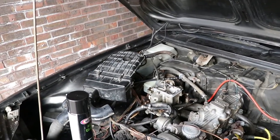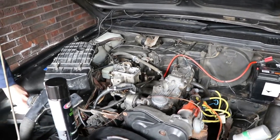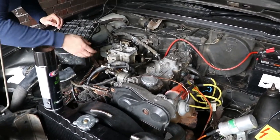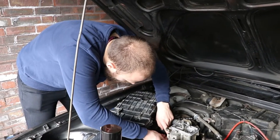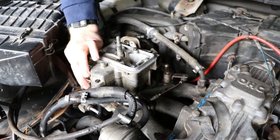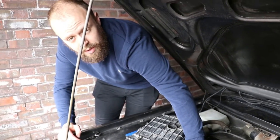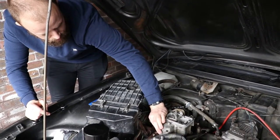There's been a bit of talk about what the issue might be — you'll have your own ideas from the previous videos. We quadruple checked the timing so we're almost 100% sure it's not that. It's pointing more to a partial jet blockage rather than full fuel starvation. These are fairly complicated carburetors. It was dirty — very dirty inside — so fingers crossed this should start nicely.